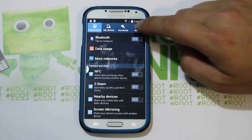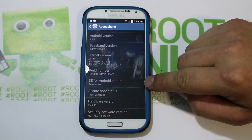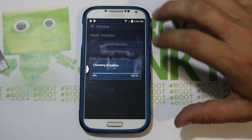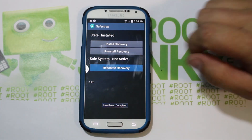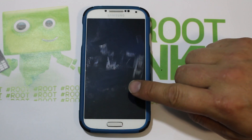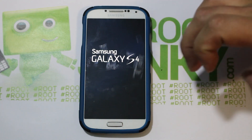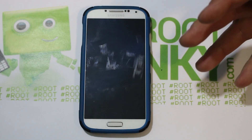Scroll back into Settings, go to About Device or About Phone, and now right here you can see SE for Android status is Permissive. Now we can install SafeStrap. Open it up, give root access, and hit Install. Before, I had buttons that were grayed out and lots of issues, but now we can do our reboot to recovery and everything should work correctly. We'll have SafeStrap 3.72 installed and functional. After the first reboot your SE Linux goes back to Enforcing, but we put it in Permissive just for the SafeStrap install.